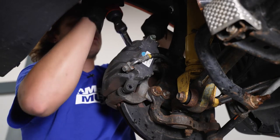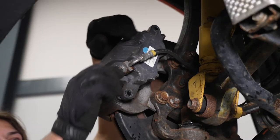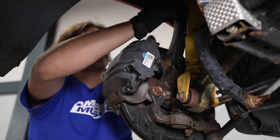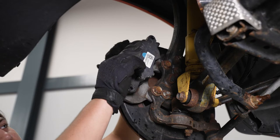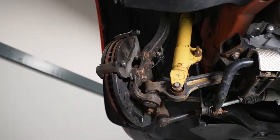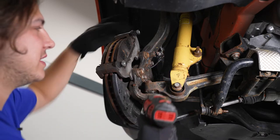Move up to the top one. Now from here you're going to want to make sure that you have a rag on the floor because there is going to be brake fluid that comes out. Just going to tuck that off to the side. Make sure you've located both of the copper bolts that are holding this in place because that is what is going to seal the caliper shut. Now from here we can pull off our caliper. So now that we have our caliper off, we're going to remove our two cage bolts. I'm going to use an impact with a swivel socket and a 20 millimeter socket to remove these two bolts.